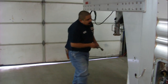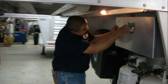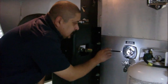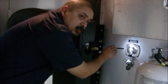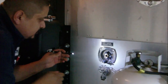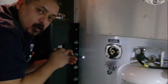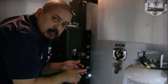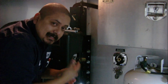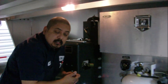Right here is a city water connection. They make a fitting here that you can use with an air nozzle — any air hose will work. Once you get your air hose hooked up here, you'll have somebody go on the inside and open up all the valves on your toilet, shower, and sinks. That is going to blow most of the water out, but it's not going to get it completely winterized. Keep in mind you will not get the water heater, nor will you get the pump.